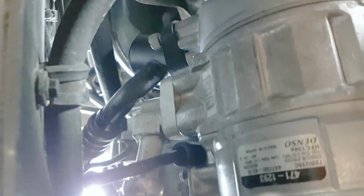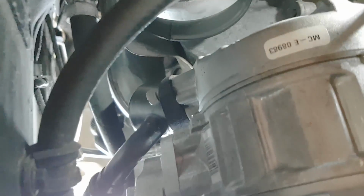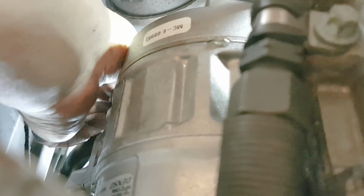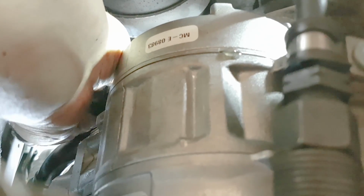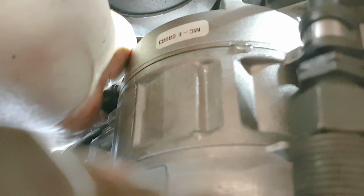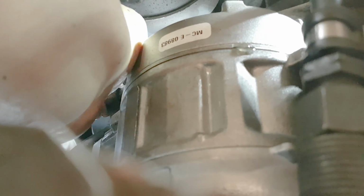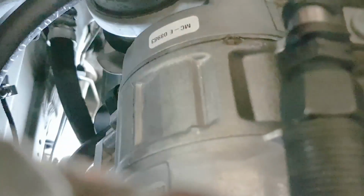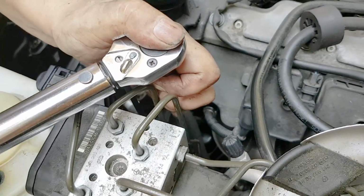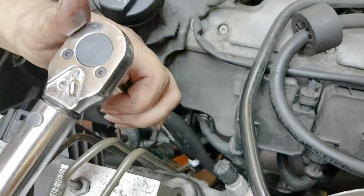So of course, anytime you replace your compressor, you will have to replace the receiver dryer. Every time you replace any of the components, including the lines in your AC unit, you must replace the receiver dryer. It's really a very cheap part, $13 or so in 2019 from fcpeuro.com. It's the Rein model. You purchase that and install it as the last item that you install, and that's exactly what I'm going to replace next, so stay tuned.